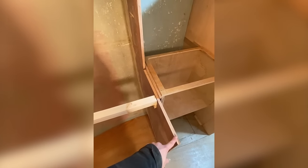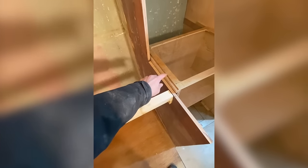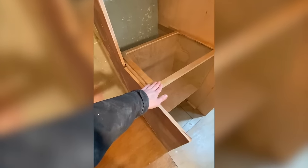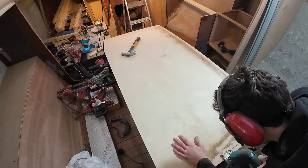This is in line with the oven box. I've cut this bulkhead down to the height to include 12mm ply on top and then 15mm worktop, which will take us right to the very top, clad with the worktop. I've also put this on a little track system so we can adjust the position before we drill any holes. This hatch here is in a completely inappropriate place — if we put a little cupboard over it, I think it might be a little bit far from the cooking area, so I might have to move or cover it.